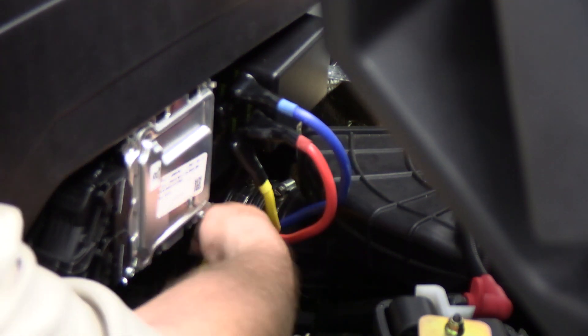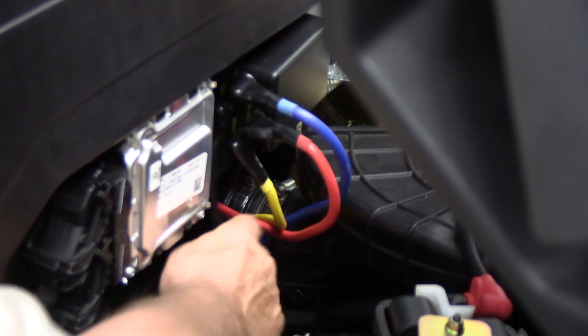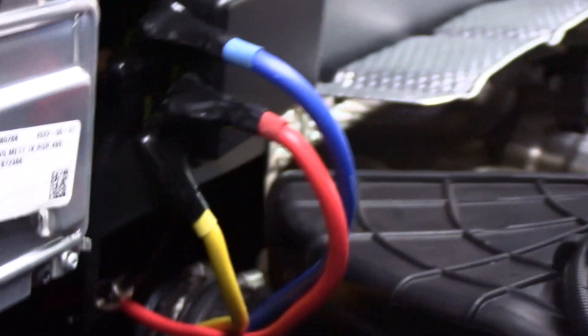The red and black lines need to go either directly to the battery or to the bus bar that has direct battery connections. Here's the red hot wire and here's the black ground wire. There's one other important wire to the solenoid — you can see the junction there — that we have run up to the front.